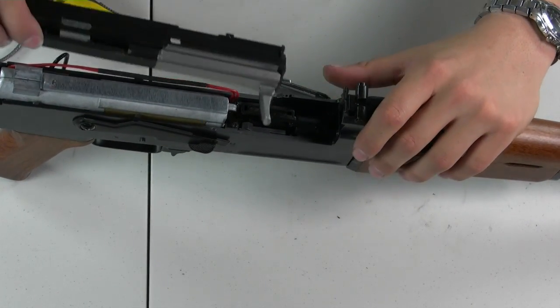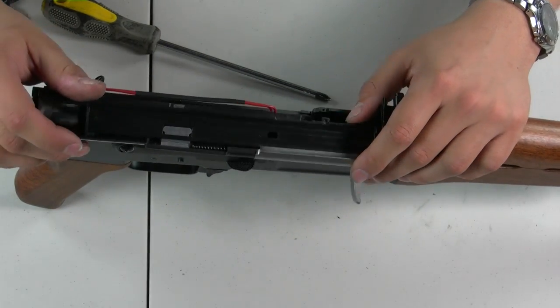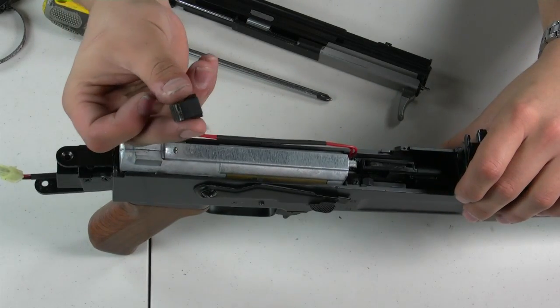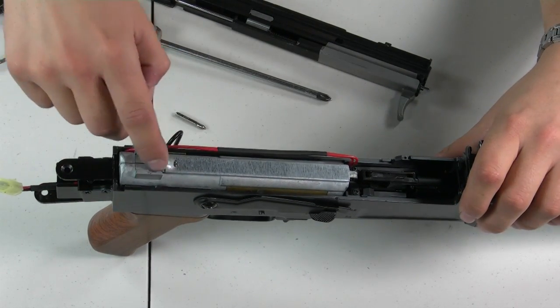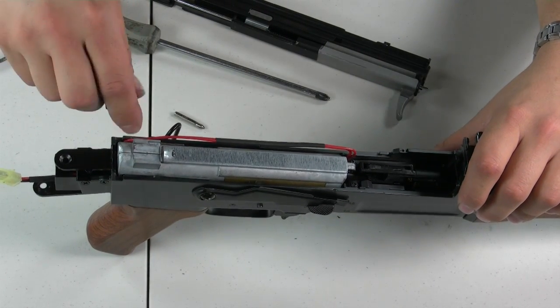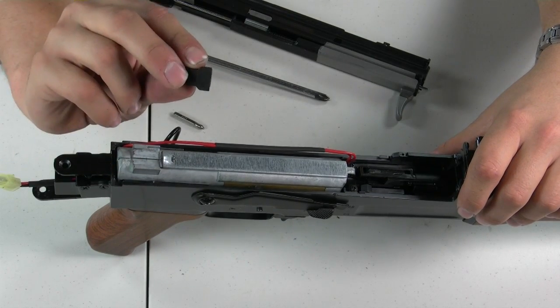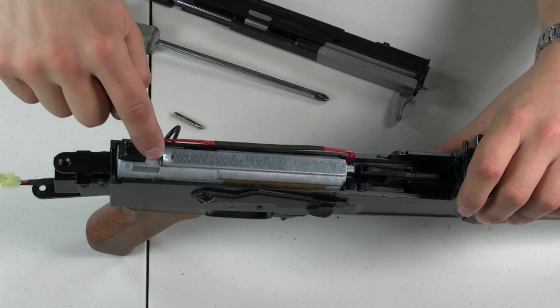Again, if you followed my step earlier, make sure you don't let this rod come out, because that just is a real nuisance to get out. But before you put this back on, you want to put your locking button in place, which is easily done. It's got sort of a tapered groove right here to where it kind of bottlenecks up right here. Just set this bracket with the wide portion of it right here, and push it back in place like that.